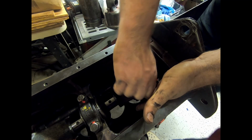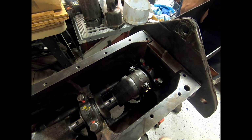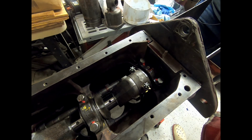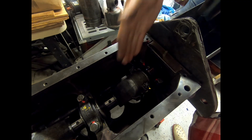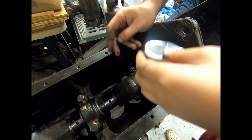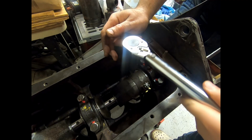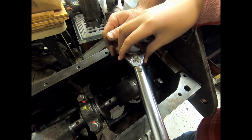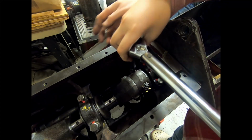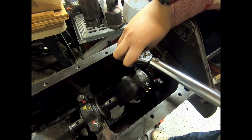Okay, what size socket do we need? The same one that's on the ratchet already that we were just using. Check if this torque wrench is 35 foot-pounds. We want to double check. Okay. Yep, that's 35. So carefully go ahead and start tightening evenly both sides. They should feel about the same when you're done each one, Jack. Keep going. You're doing good.